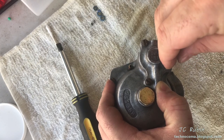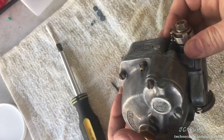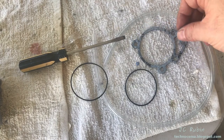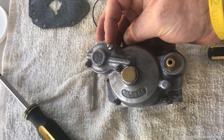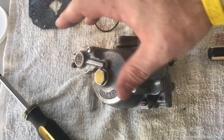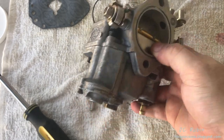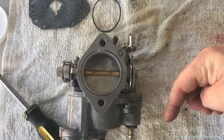The final screw also serves as the screw to hold the bowl on as well as the accelerator pump diaphragm piece. This assembly is now fully completed. This is the o-ring that goes up here — I'm going to wait until the carburetor is installed to put this on. It's going to go back in the packaging, which also includes the gasket for the other side of the carb that will go in at installation time. The carb can now be checked for leaks and the float level can be verified. Note that if the carb is opened for any reason, only the silver screw here and the three down below would be opened — no need to open the other two to access the float bowl. That concludes the video on this S&S Super E Shorty rebuild — I hope you found this video enjoyable, educational, and helpful.